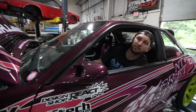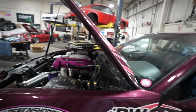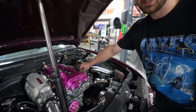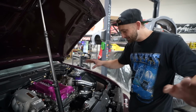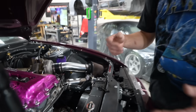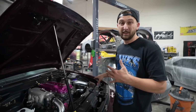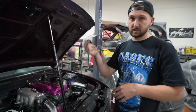The dipstick popped open on me a little bit. You'll get that on the SRs. So the dipstick pops open, just splashes a little oil in the manifold. And you shouldn't shut your car off that fast after beating the crap out of it. It's just a built engine thing. So I got splashed oil in my manifold. That was the smoke, no big deal. While it was on, I was looking at the coolant pressures. They did not exceed anything that I was worried about. I really didn't see it move much, which is really good to know, because before it would just spike instantly.